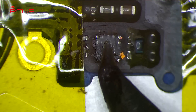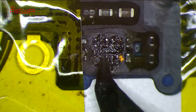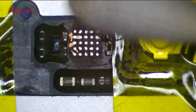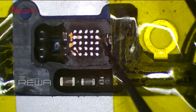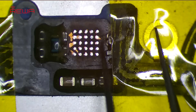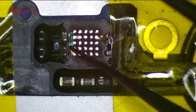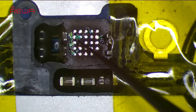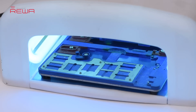Clean its bonding pad with a soldering iron afterwards. Due to the precise structure of the home button cable, heat applied during the operation might result in coming off of the insulating coating. We need to apply some UV curable solder mask to the exposed area for insulation protection before soldering the chip. Then solidify the home button cable under a UV dryer lamp for 15 minutes.